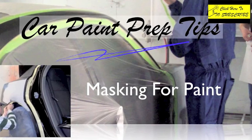You want to start masking your jambs first. You want to start inside out, because if you start outside in, you may trap yourself to where the whole side of the car glass is masked off. You have to cut it open to get the door open. So it's always a good idea to mask the jambs first.